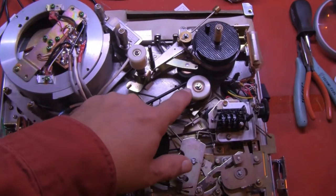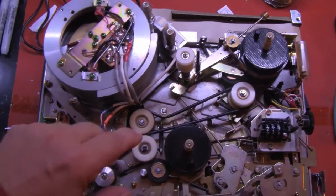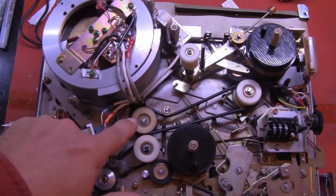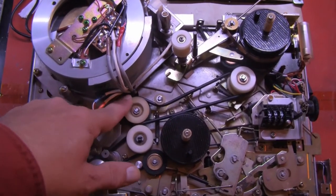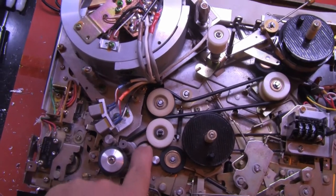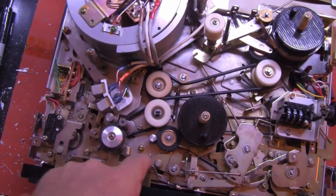Initially the belt was slipping here, so I replaced it with the large 11.7 round belt. And now this wheel can slip, although not nearly as much, and now the short belt down here from the capstan to the first idler is slipping. And as you can see, I can push it too far — that's too loose.